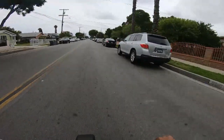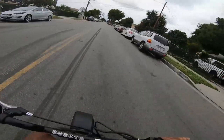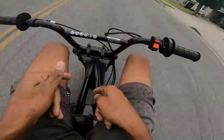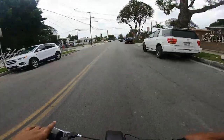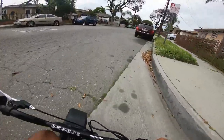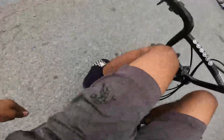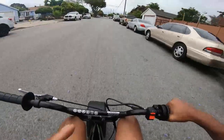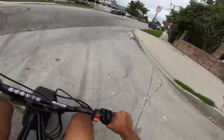I got a lot of ideas — I might get the gold power stretch kit with brakes and front suspension. For the motor, I can upgrade it. They do have carb upgrades and exhaust for this 105cc, and if you want to get it up to around 50 mph you could do that. But in my opinion, take this motor off and swap it with a 212 Predator or a 224 — anything in that range and you'll have a lot of fun. I'm probably gonna go to Fasty Mini Bikes and see if they can give me a 35 chain setup for this gear without needing an adapter.